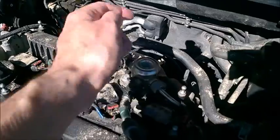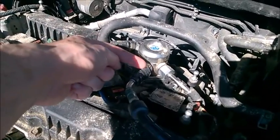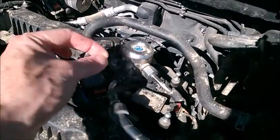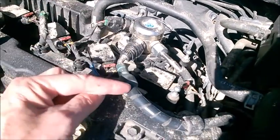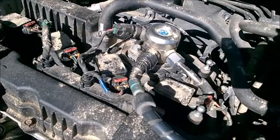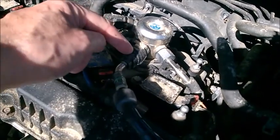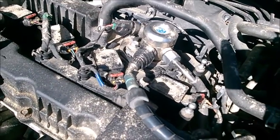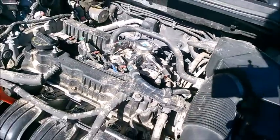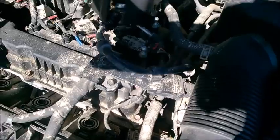The noise you heard in the video comes from another car. The first suspect for that noise is the tappet — the part that sits right underneath the pump. I'm not sure exactly how you access it, but you likely only need to lift the pump. That roller tappet is about $100 US, and I'd guess it's the part that fails first. Replace that first, then check if the pump is still noisy. Also be aware: there is a high-pressure fuel hose segment here — this is not standard fuel pressure, this is really high-pressure direct injection. One forum user said he reused that hose segment and it started to leak. So use a new one. Blame the tappet first, then blame the pump — don't replace the pump first. And try to keep the foam in place; it might keep the pump a little cooler.